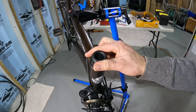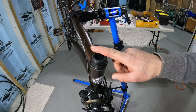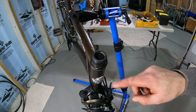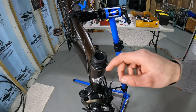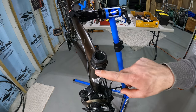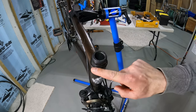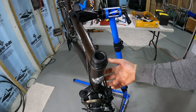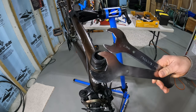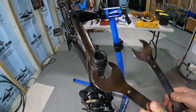The next thing is to remove the top cap. There are two nuts here — the top one is basically a lock nut that tightens against the bottom one. The bottom one is the bearing cone, which presses against the bearings that sit against the top bearing race. Once you remove that lower nut the fork can drop out of the head tube completely, so be careful. To do this you can use headset wrenches or a pliers wrench — you'll need two tools.